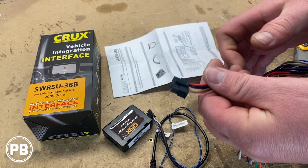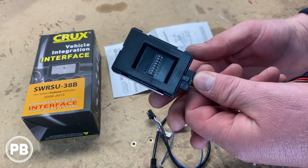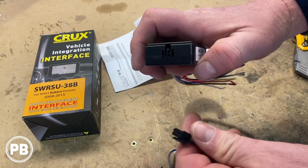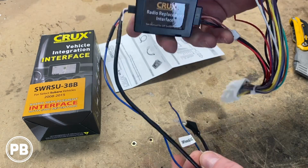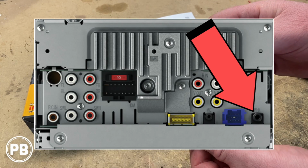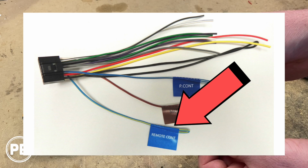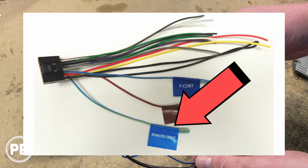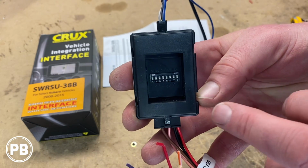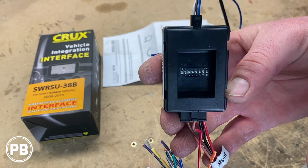And this is your plug for your steering wheel volume controls. So this end will plug into the module. Now this is your volume control harness here. Essentially this end will plug into your module right there. And this one will plug into most aftermarket radios that have a 3.5mm jack input. Or if you don't, you have the Kenwood JVC version of it as well. Now on your brain box you have some dip switches, which we'll cover here in a minute, but essentially this helps us identify the type of radio that you'll be installing.